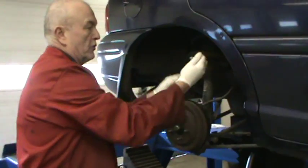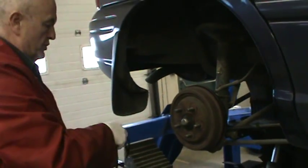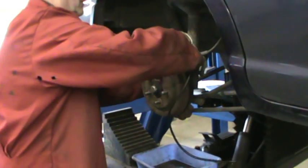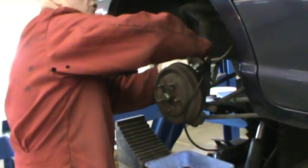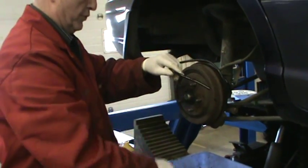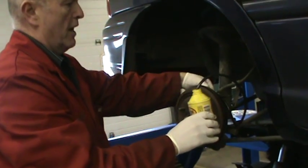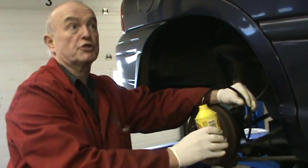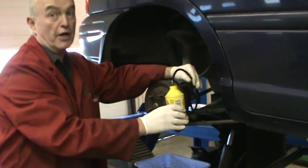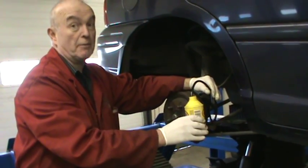I've removed the little cap and I'm going to take my wrench and open the bleeder. I've selected this hose — it's the most common one but we do have larger hoses — and I'm going to push that on the back of the bleeder. It's open about two turns. I'll have my wrench available and immerse the hose below the one-inch level of brake fluid. I'm going to hold the hose and give the directions: six times please. I can hear and feel the air coming out, and that's what I'm concentrating on. If I'm not happy, I'll call six more.